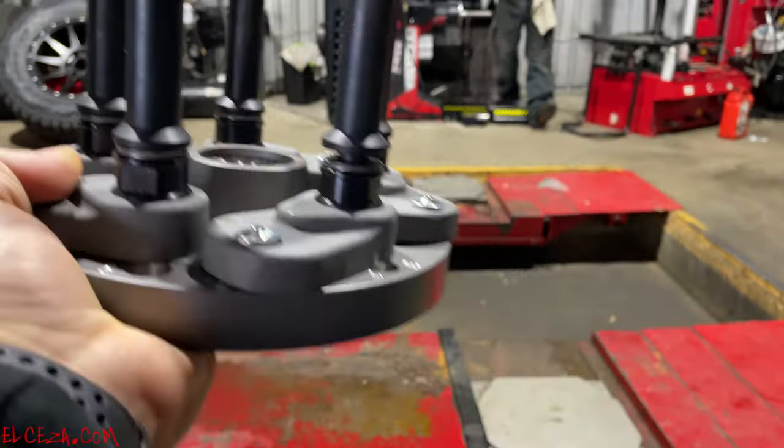If you get that situation again, if you think you do, take it off, unchuck it, put it all back together, make sure everything's tightened back down, and spin it again, see if it does it again. Odds are good it won't. It did slip. Now, this balancer will also tell you slippage detected. If it moves too far, the balancer will go, nope, start over. It's that smart because we're using those cameras to profile.